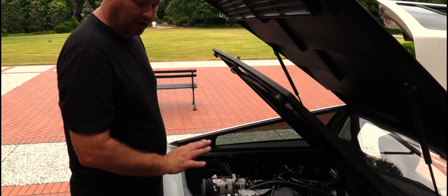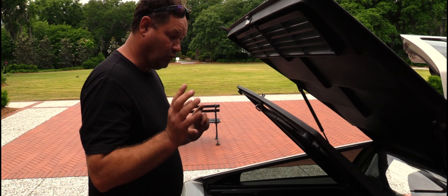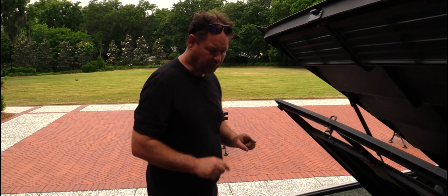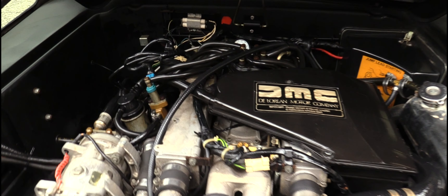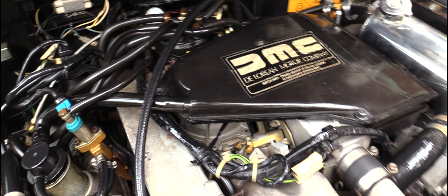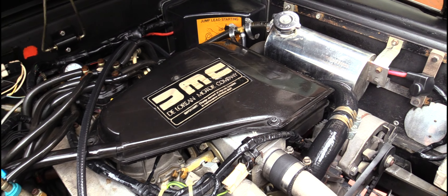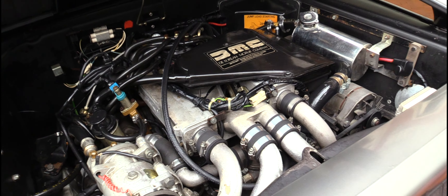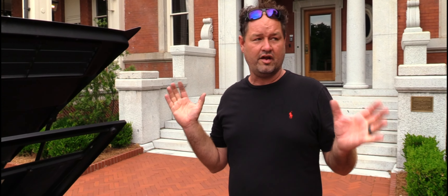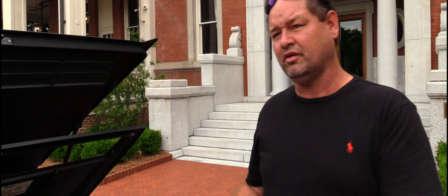When I received the vehicle, four calipers had been completed and the water pump had been completed, though I didn't have any paperwork showing that. Your warm-up regulator for cold starts — I took care of all those. While I had that off, I came back around and took care of the frequency valve. John Hervey would sell them cleaned out and refurbished. The car ran like a top — replaced three parts and it did like it should. I think I did the plugs at the same time.